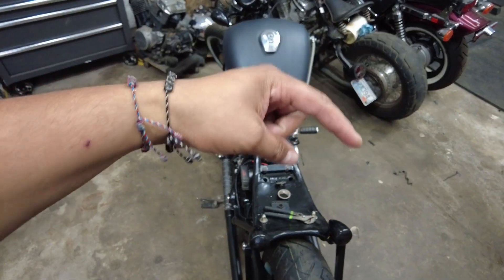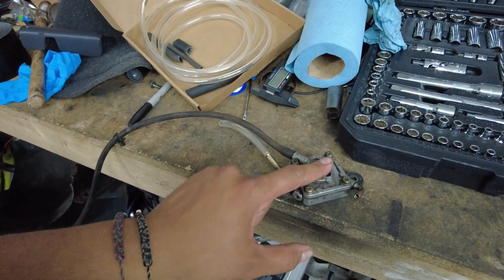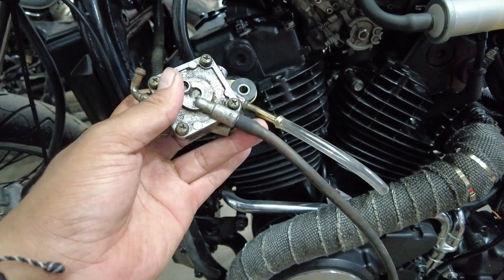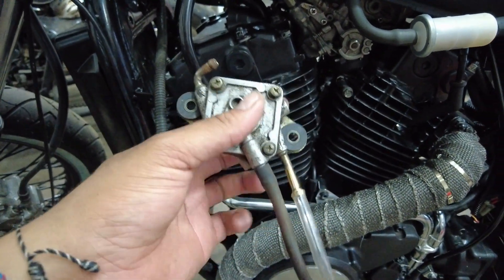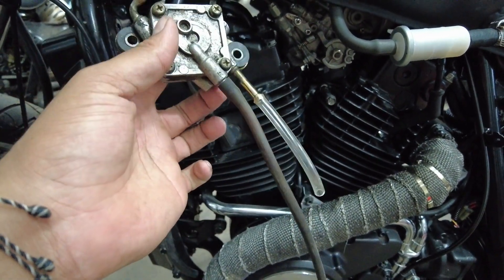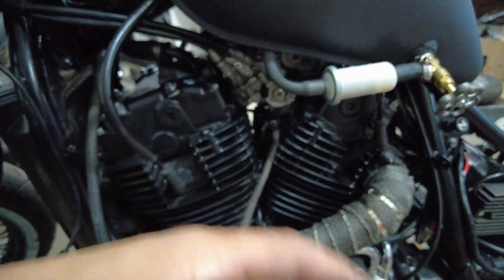What's going on guys — if you're new here hit that subscribe button, trying to get to a thousand subs. For today's video, I still haven't gotten this part in the mail, but I basically just took this off a VT500. What I'm gonna do is wire this up to this bike. This black hose right here uses vacuum to pump the gas from here to here, so I'm gonna switch out the lines for clear lines and see if this actually works. My vacuum is gonna go from here to here, so I'm just gonna pull this out and connect it. Hopefully this works and it'll resolve my gas issue.